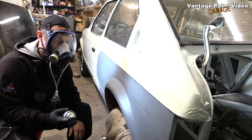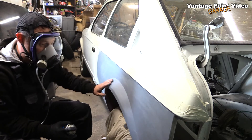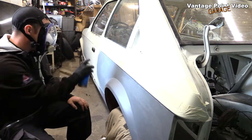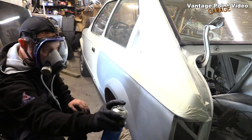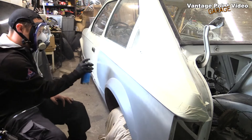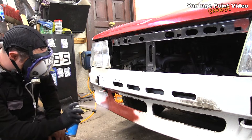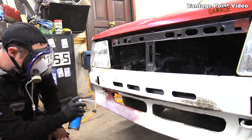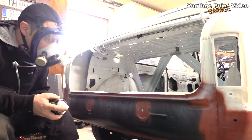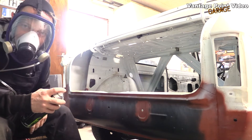It's pretty much the same story on this side. There was already some grey primer on it, so I just extended that on over the red on the arch, just to even things up. I'll start now with the white primer. There's a bit to do here at the front as well. I need to get primer on this black area too, and it'll even it up with the red bits before I put the white primer over.